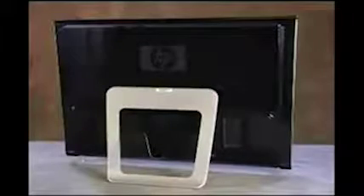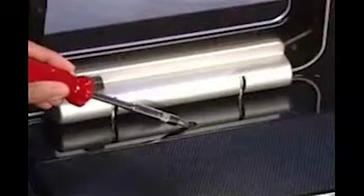To remove the hard drive, lock the stand by pulling the stand upright and sliding its locking latch. Detach the single screw for the hard drive and memory cover, then remove the hard drive and memory cover.